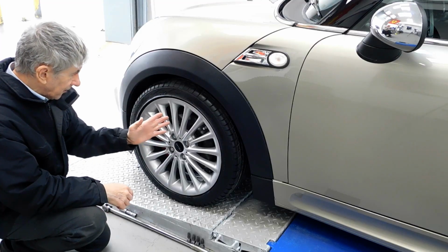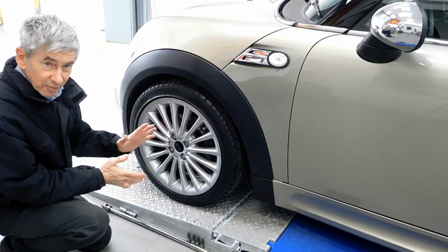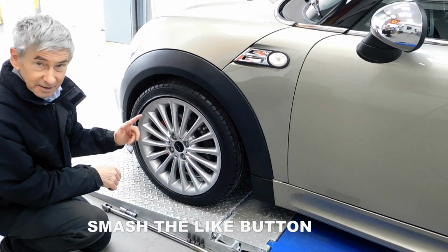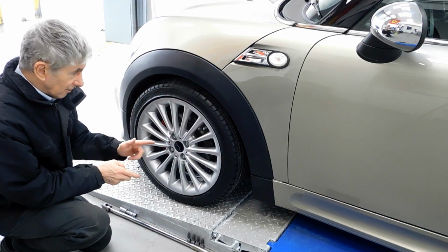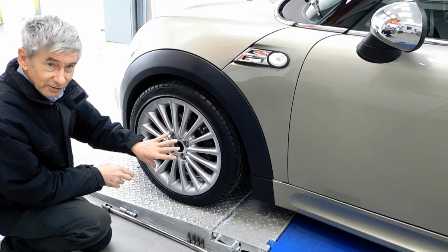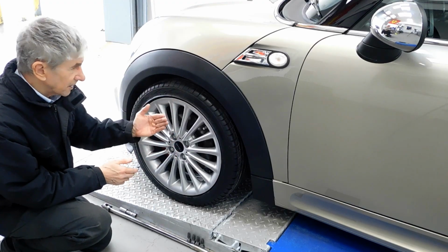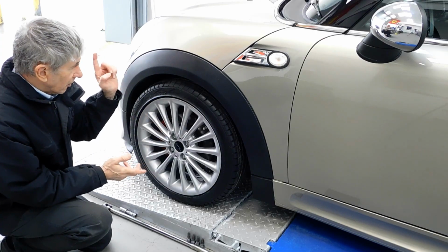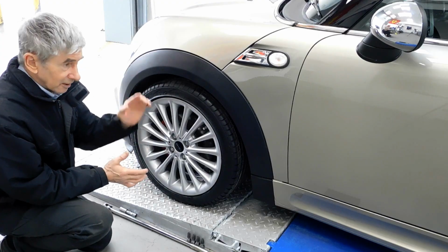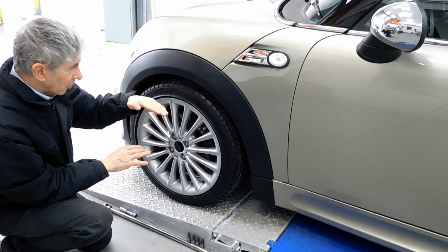Sourced these wheels off eBay, had them fully refurbished, also fitted new centre caps, and painted the calipers red all round on the vehicle. Fitted 11mm spacers to the back of the wheels to bring them further out and fill the arches up. Also put lowering springs on, 30mm all round, so when they get embedded in it will lower down a bit more yet.